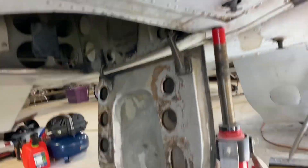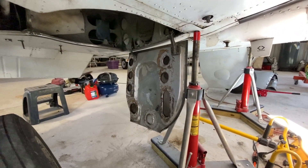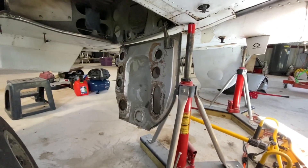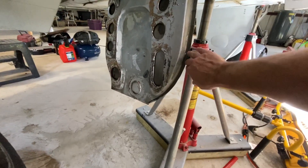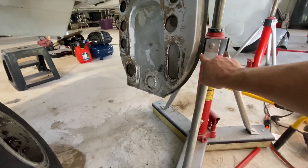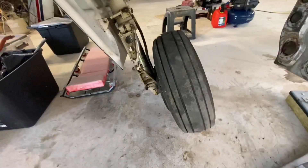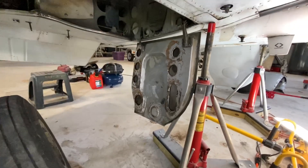The main landing gear doors come down, you have to be very careful. For those of you familiar with Beechcraft — whether Bonanza or pretty much any general-aviation-size Beechcraft, not King Air or Queen Air, just lower GA Beechcraft — the way their doors open up and come within reach of your jack, you have to be very careful about footprint placement, because the door comes and it's right there. If you don't get that right and you drop the gate that far, the door is all the way wide open almost before the gear has even started coming up.